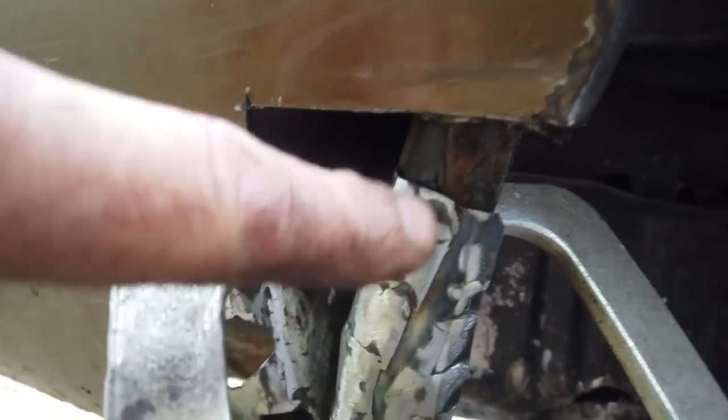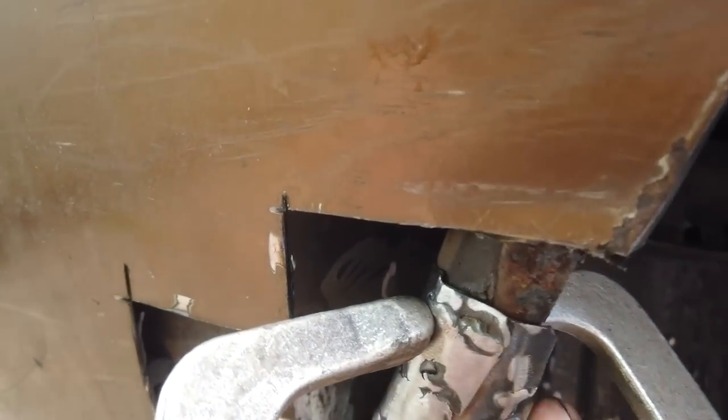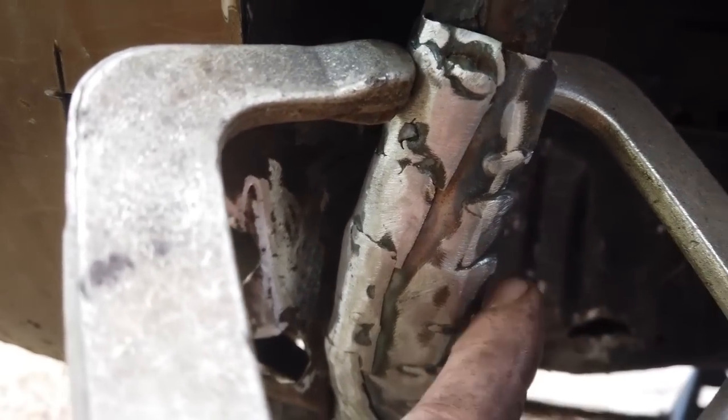And then it's a butt weld up to the top. There's one slight overlap I've left to keep the line, so I could keep that line in shape. Well, I want that lip just hammering flat once I've welded, but that's ready to weld on.